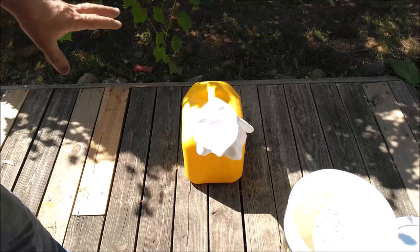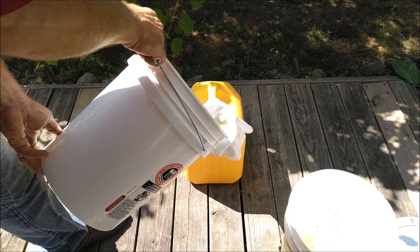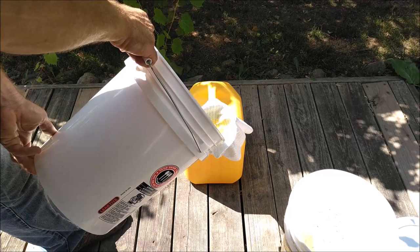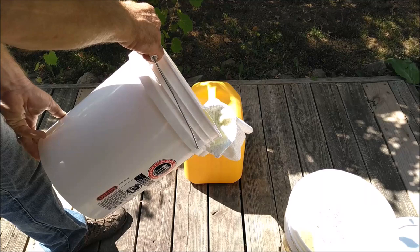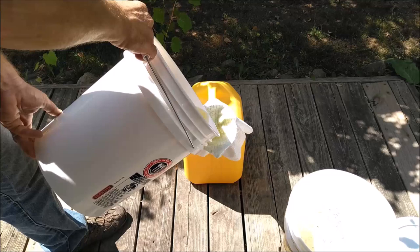I decided to go with a longer funnel as opposed to one with a wider mouth on it, because I want that funnel down in there where it's not going to tip over or fall out — since I'm doing this by myself. So I'm going to pour really slow here. I'm not even sure if this terry cloth is really filtering anything; I'm more or less doing it as an extra added measure. The fuel looks really clean after going through that filter. I got the filter on Amazon — I'll include the information and a link to the Amazon page in the description. They had different filters you could place on top of a bucket, and I took the one with the smallest microns I could find.